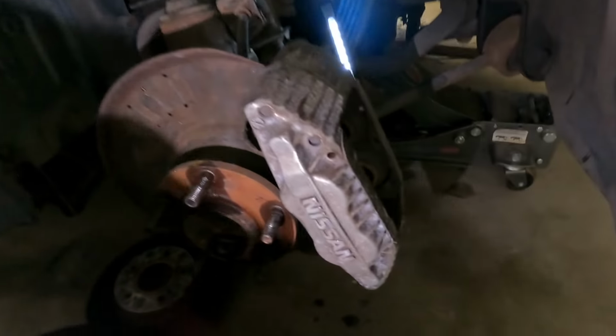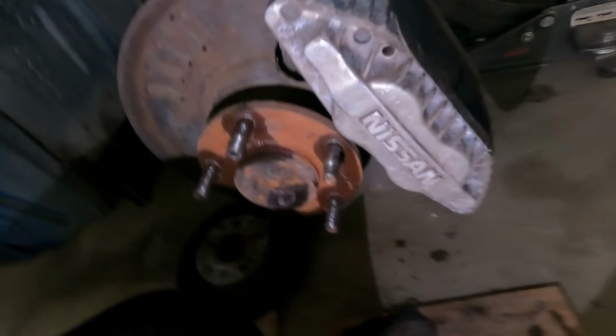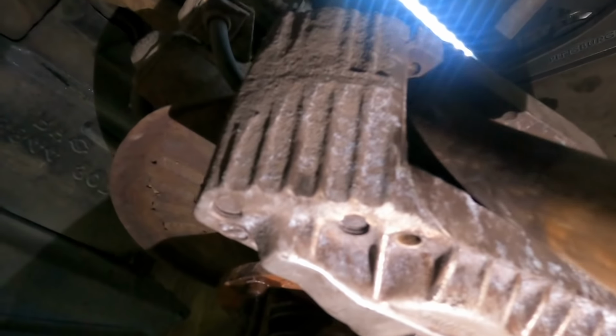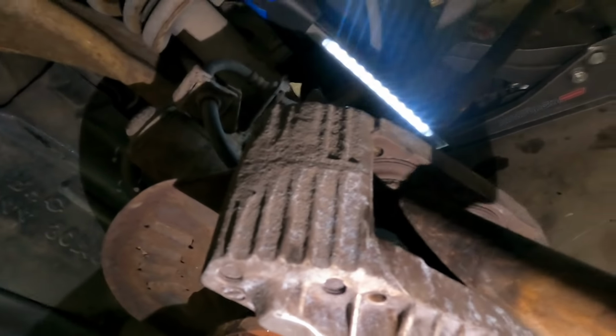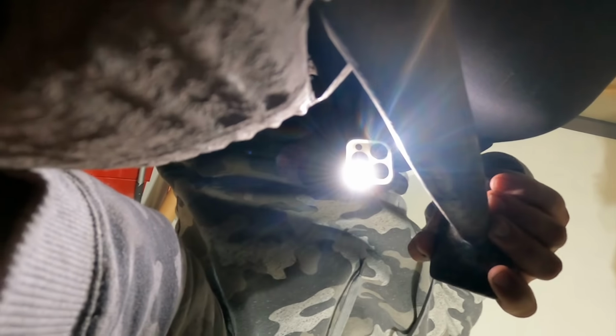So now what you got to do is this. You got to get yourself a hammer, and like I said, push these two pistons down with this. All right, and like I also mentioned, have one hand pushing down and the other hand over here pushing the opposite way, so both hands can work simultaneously towards one goal. All right, and that's for these two pistons right here that are exposed.